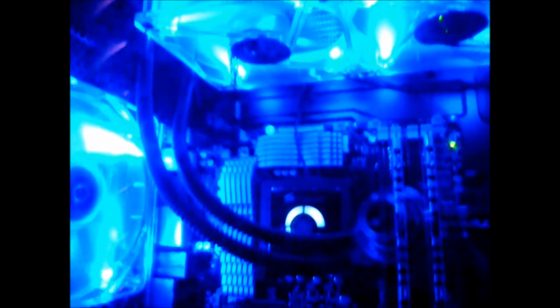And then at the same time I put my son's together. I didn't really showcase it on the last video, but he's running a similar setup with the Core i7. I got his at 4.9 at 1.40 volts. That's a screenshot of his prime blend. I got him on a 25-hour prime blend, stable. So here's his rig down here. Same thing, the 810 switch. He's got an NZXT Sentry fan controller, just a 6 fan, and he's got a Corsair H100 water cooled. So yeah, his rig's definitely nice too.